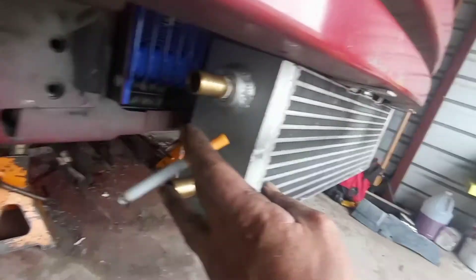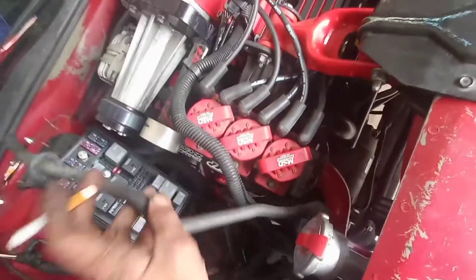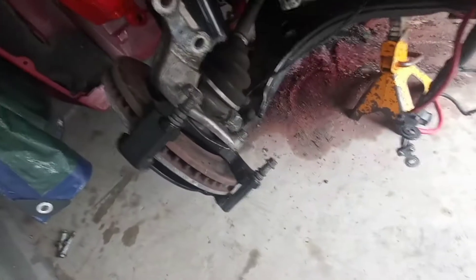I still need to get one-inch inner diameter line for the front mount heat exchanger and mount the pump somewhere with the fill neck. I've got to run this set of wires back down to the radiator fans and plug them into the fuse box. The coolant tank is still in the trunk. I still need to get all the suspension hooked back up — knuckles back in the struts — but it's all coming along and I cannot be happier.